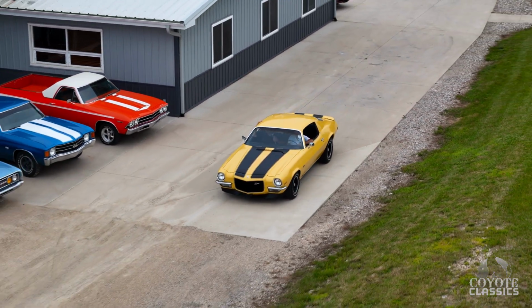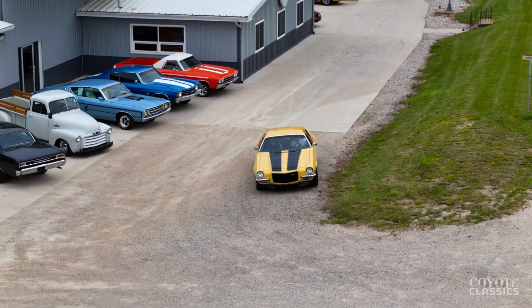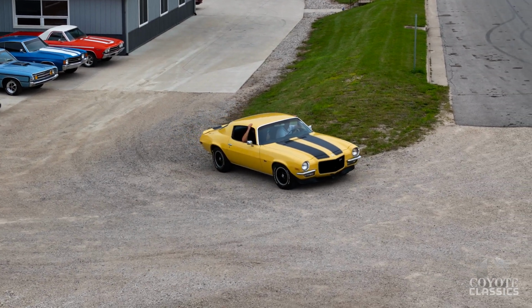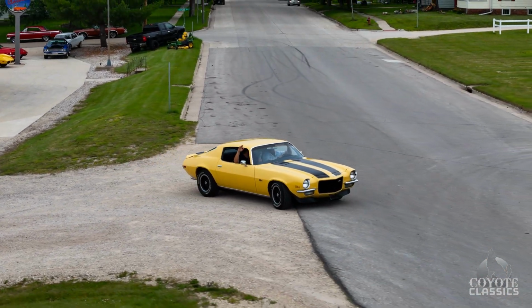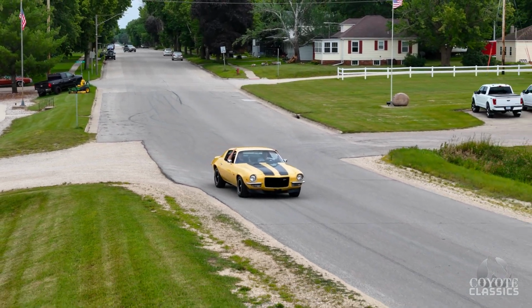It's a lot of fun to drive, and it handles really well too. We're gonna take it a little easy just in case. Like I said, we're struggling with that master cylinder right now. We got it. Should be here by now, I would think. Yeah, I think next day or two. Mike's gonna call NAPA this morning, because 90% of the time it'd work great, and then when we pulled it in the showroom, we kind of lost a pedal there. So we're like, yep, master cylinder, gonna need one here soon.